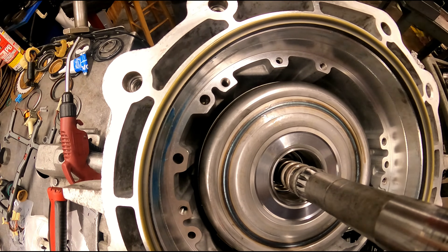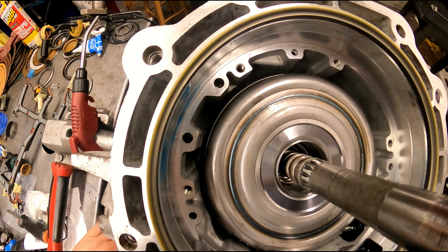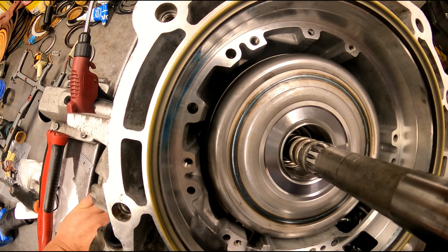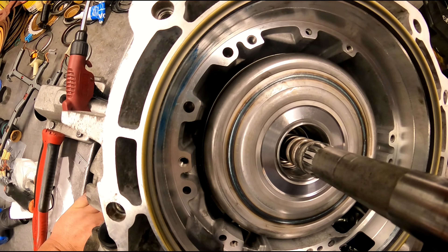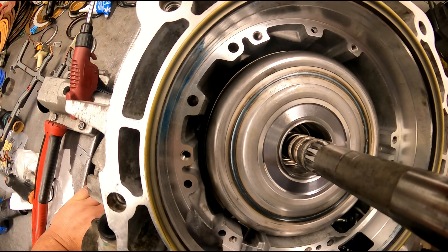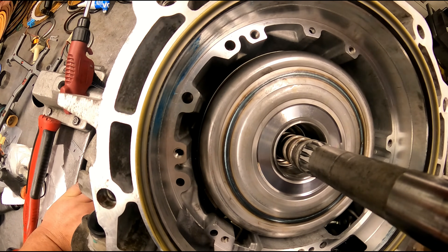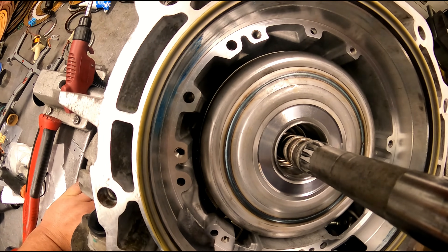That's a bit much. The extra long is gonna be way too long. A number three groove would probably work real well but I don't have one, so we're going to go over what you can do when even the longest one isn't enough. I have run into where the extra long pin was too short — way too short. That means the drum is way too small. I've been running into it even without replacing the drum — it's way too loose, and there's something going on with the bands.